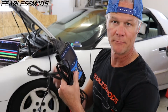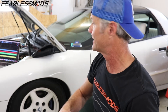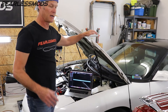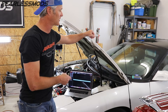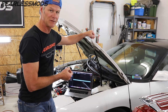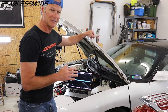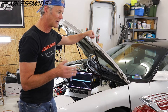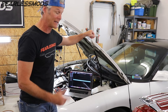So I'm going to go ahead and plug in the scanner and clear the codes if there are any so we can start it up and give it the run check. We have gone through disconnecting the negative of the battery for 30 seconds, removing the PCM battery fuse and then the PCM ignition fuse and letting it set for 10 minutes — and that also did not get rid of the eight codes. I don't know why we can't get rid of those codes. Please let me know if you have any suggestions for how I can clear those.